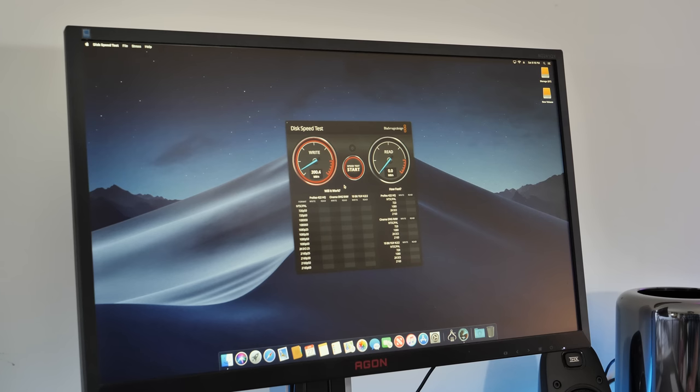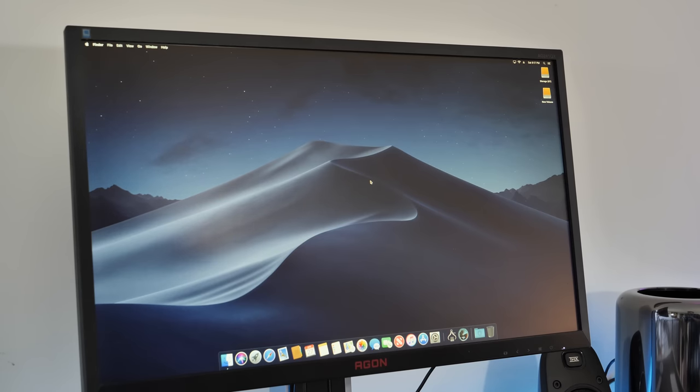It's not the fastest drive. The write speeds are a little bit worse than the normal SSDs you'd expect for these things, but the reads are a lot better. Normally you'd expect about 600 write, 700 read from an Apple SSD of this era. I'm pretty happy with that, but the SSD that I have lined up is a lot better, so we're going to go ahead and switch to it.